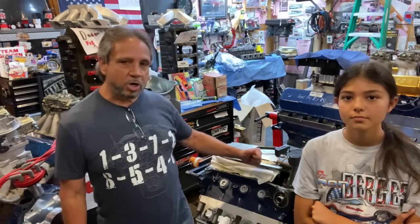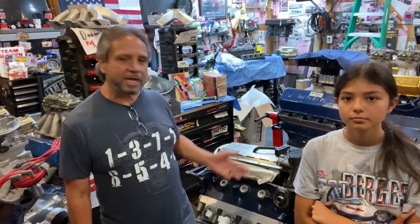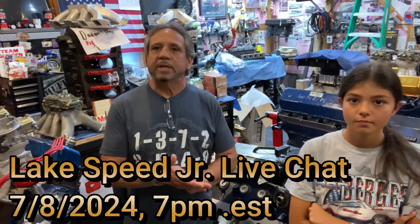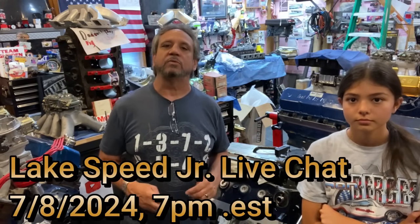I talked with Tom Molnar — he's going to hook me up with new cranks and rods. We're going to take it apart now and see what it looks like, because I'm trying to get this episode ready for when Lake Speed and I talk about oil analysis. The engine is going through the traps way too high — 83, 84, 8400 RPM. It doesn't need that. It needs to be right about 7900. I bet I pick up time. I'm going to have to change the gears to probably 4.30s. It's got 4.71s in it now.